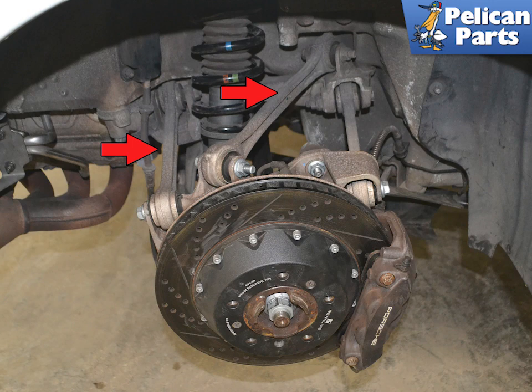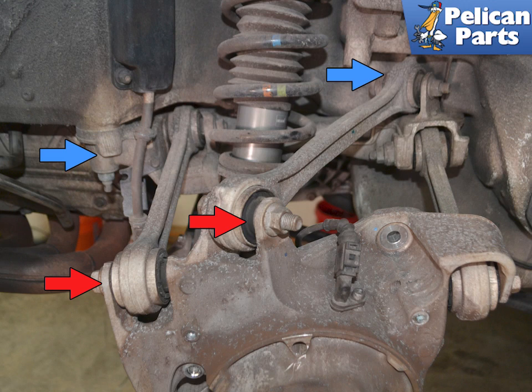There are two upper control arms. The upper control arms connect to the wheel carrier and the chassis via a subframe, or what Porsche now refers to as a side carrier. The upper control arms, like all the arms, allow for the movement of the wheel carrier for the shock and springs to function, and handle both lateral and longitudinal torque or forces.